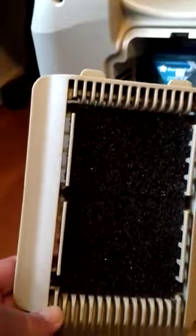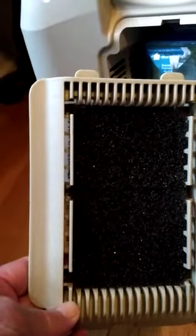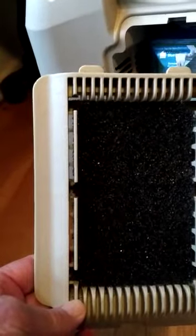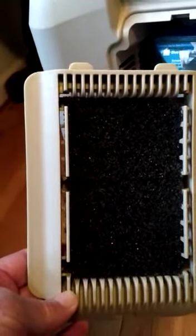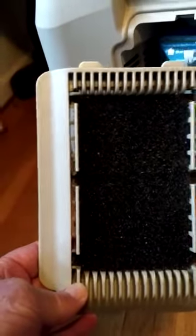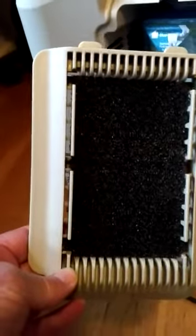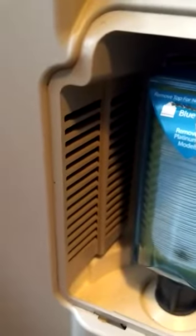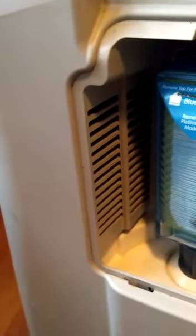The question is whether you can use a thicker filter with smaller holes to remove more dust. To test that, we have to see whether the pressure, the flow, and the oxygen level are affected, and also the temperature of the compressor — because a thicker filter will slow the cabinet airflow into the plenum and through the slots, potentially affecting the cooling of the compressor. Those are the four parameters I had you measure.